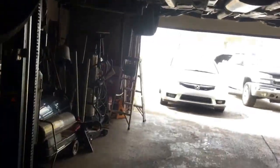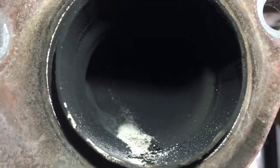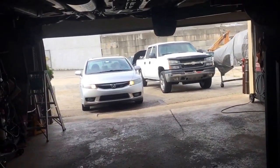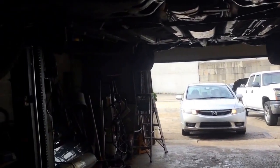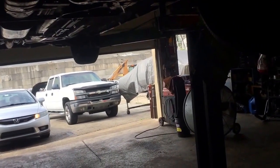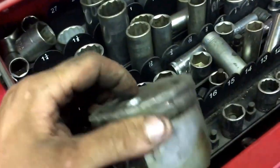Right away I could see a piece of the catalytic converter right here — not the black dust, but actual sparkles, like a little bit of dust. Take a flashlight and look down in the exhaust and you'll see more pieces — see all them pieces moving around. The catalytic converter is sucking debris back into the motor from the top side and it's killing the piston rings and walls because it's metal — it's tearing it up in there.